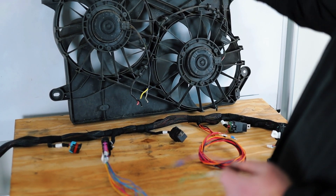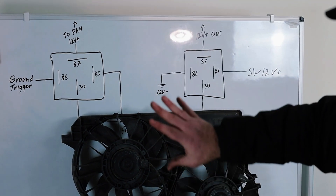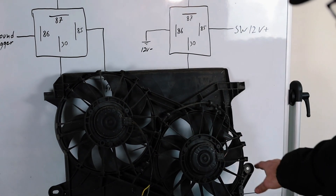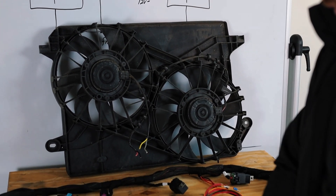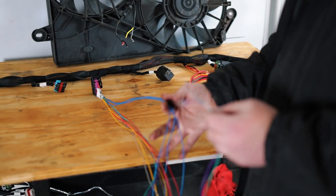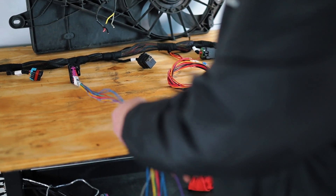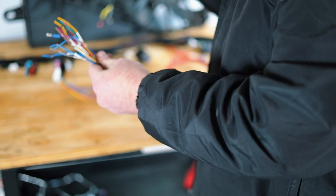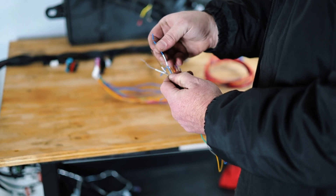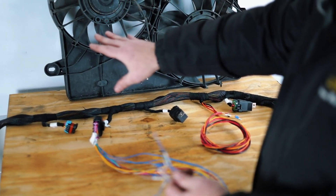You want to use a relay, which I have a little diagram behind me here that I'll explain. We'll draw it out on the board. So ground triggers right here, fans right there, harness coming out of the additional wiring harness — no big deal. One thing we can also note is the AC fan wire. On this harness, which is one generation older, it's called a rev wire. This is also a ground trigger to turn on an AC fan.